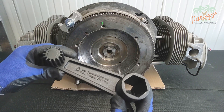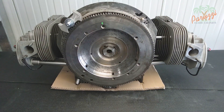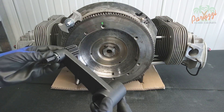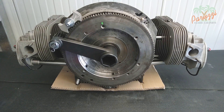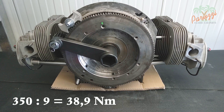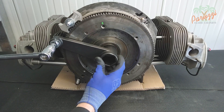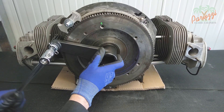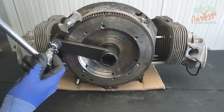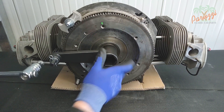This tool comes with a drive sprocket for 6 volt motors and a drive sprocket for 12 volt motors. It works as a power reduction system with a reduction of nine — that means you have to apply nine times less force. Instead of 350 Newton meters it is 350 divided by nine, which is just under 39 Newton meters. Using an 11 millimeter socket wrench, turn the tool around against the flywheel and the gland nut comes loose without having to apply much force — there is no need to stabilize the engine.